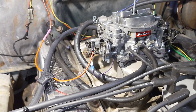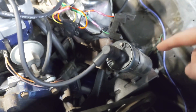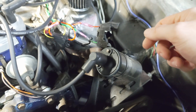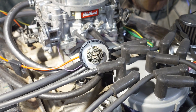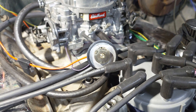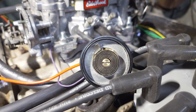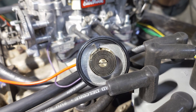Here's a good way to test your choke. First, unhook your coil so it isn't getting power while you're testing. If it sits with power too long without being able to discharge it with the motor running, you can burn up your coil. To figure out if your choke thermostat or choke cap is your problem, you can take it off the carburetor but keep it hooked up to the wiring, then turn the car on and watch to see if that spring moves.